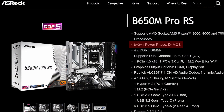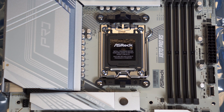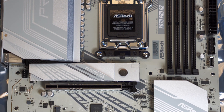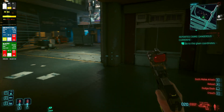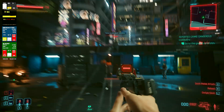The first thing to know is power phases. Motherboards sometimes list things like eight plus two plus one power phases, and what that actually refers to is the VRM setup on the motherboard. This is responsible for power delivery to components such as the CPU, which is quite important — if your CPU isn't properly supplied with power that's clearly not good. But if you've got a mid-range CPU, this isn't really something to worry about. You could buy a budget motherboard with a budget VRM setup and you're probably not going to have any real issues. But if you were buying an EPYC or Threadripper CPU, things like that would become a lot more important.